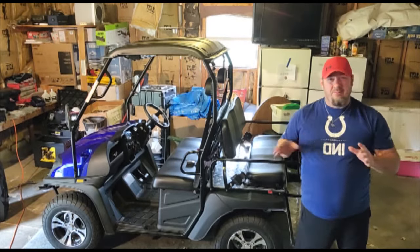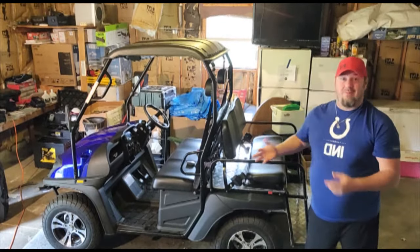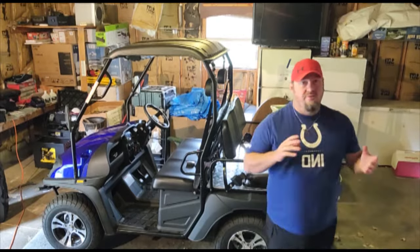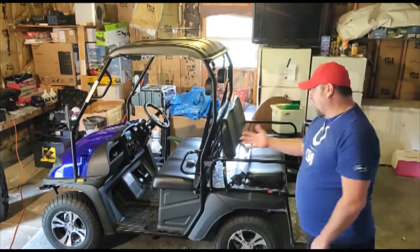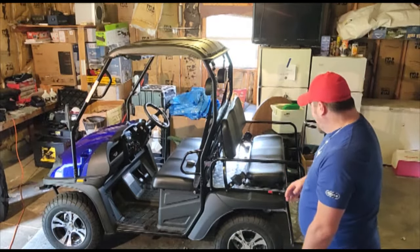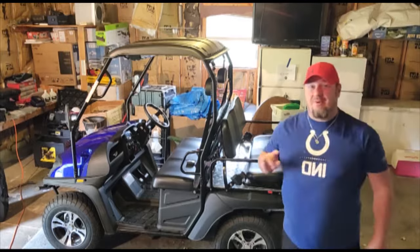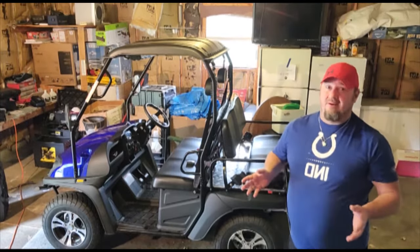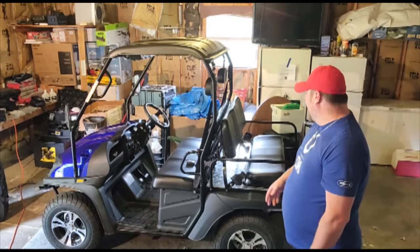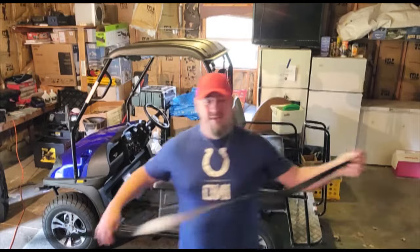I want to show you how to get the golf cart apart, get to the engine, change your oil, and show you where the speedometer cable is, because that was a big issue I've also seen other people search for. Overall I want to give you a first review. I took the blue color — I love it. They had red, gray, about five or six different colors. It came out of Texas, and when you get it, go through all your nuts and bolts because they're only tightened just enough to hold together. The gear shifter is terrible and the mirrors are barely on — a lot of vibration.